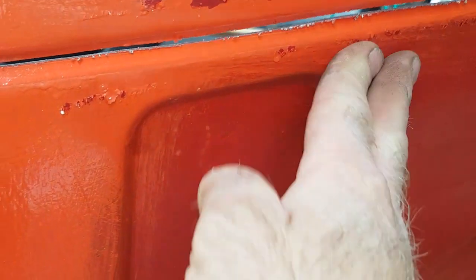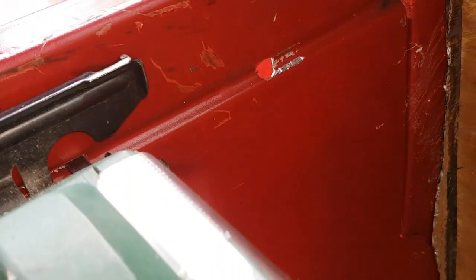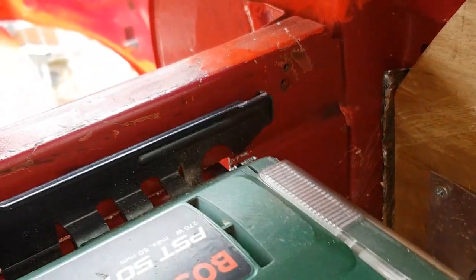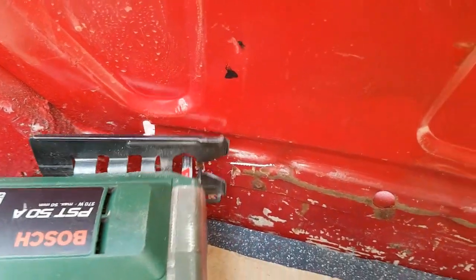I'm going to cut out this panel. What I've done is used an 8mm drill bit — one here, one there, and one at the far end. I'm using a jigsaw to cut around. I've got a metal jigsaw blade — just follow the line, see there, follow the line. Go right to the corner, right to the corner. I slid the blade underneath so I'm going to cut along as far as I can go.